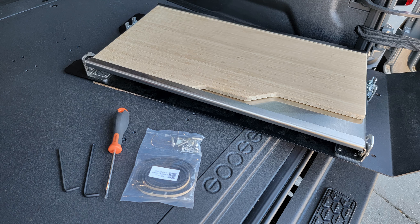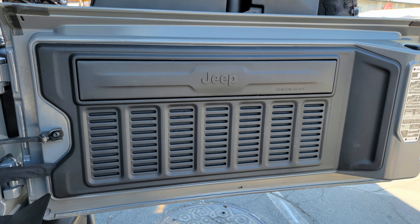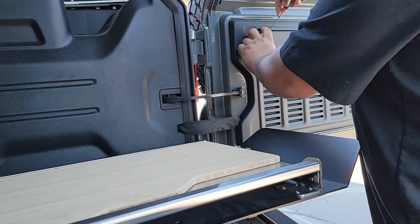When you open the box, you're going to be pleasantly surprised by the fact there's not 100 unassembled parts. Goose Gear has done the majority of the work making sure that the backing plate, the hinges, and the locking mechanism are fully assembled and ready to install. They've only provided you with some hardware to put on and some sealer that goes around the backing plate when you mount it to the tailgate. Let's go ahead and get that tailgate panel off so we can expose all the holes we'll need to look at to put the proper bolts and bushings in to get that backing plate mounted correctly.